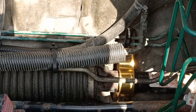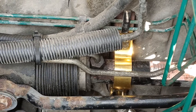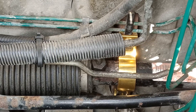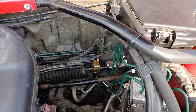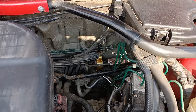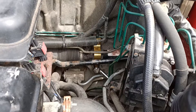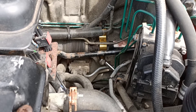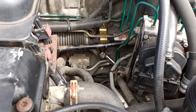So that's all back together and here's the first test — and it's a failure. You can see the steering rack itself moving around inside the mount. We were warned about over-tightening but we thought let's tighten it up even more, and although it looked good at first it then failed completely — it moved even more. It looks like we started to strip one of the nuts. So we sourced a replacement nut and this time used some foam left over from doing the PCV upgrade on the 9.5 as a spacer.